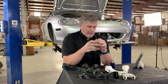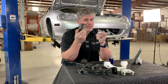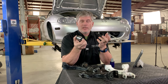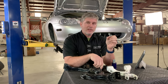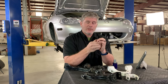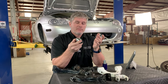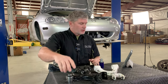Exactly what the lifespan will be — it's hard to say. I think the factory bushings have a lifespan of maybe 100,000 miles if you're lucky, and I know a lot of people run them longer than that. These will probably start rattling effectively when they do start wearing out, so that will be a little more obvious than a worn set of rubber bushings. I'm personally putting these on one of my cars because I'm not concerned about the longevity, especially given the fact that this is a very high performance car. If you're looking for maximum performance and maximum precision, I think it's a good way to go.